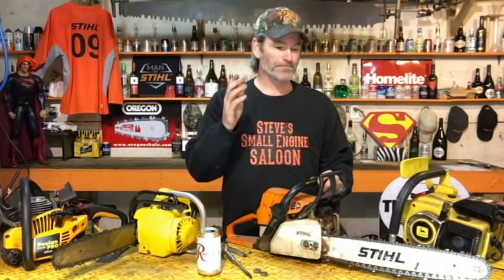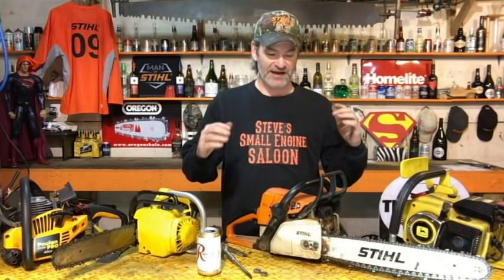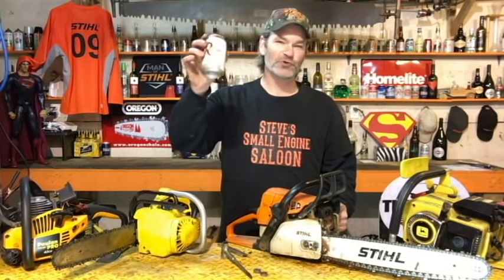Check it just like that — you can see that nice spray of oil coming off the tip of your bar, and you know your chainsaw is oiling properly. I hope I saved some of you guys some money out there. This scenario comes across my bench on a regular basis where that was the only problem — just a plugged guide bar. It's really just general maintenance: keep your bar clean so it lubricates your chain properly. Until the next video, if you liked it hit that thumbs up, subscribe to my channel. Cheers from Canada — Steve out.